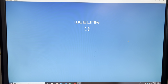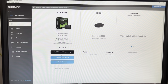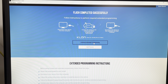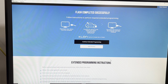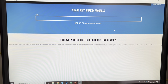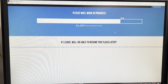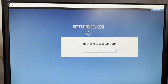Click the profile and it should auto-detect your vehicle. You're going to have 'StarTX Extended Programming' — click that. You can do multiple units; this is the fourth one I've done. Once it's done it'll prompt 'Flash Complete, Successful' — click OK and you are done.